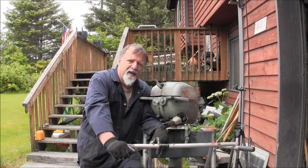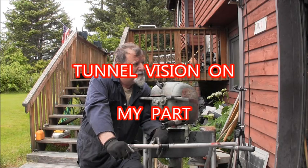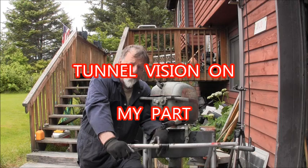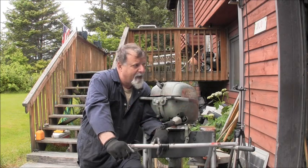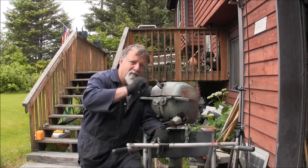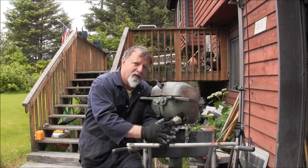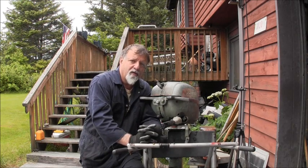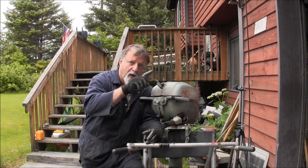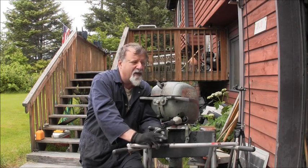So then I pulled the head off and I found the scoring on the upper cylinder. But I just cleaned everything really good after giving it a light hone. And do you remember when I was taking that pick and cleaning those channels around the piston sleeves, the water channels that run around the pistons, and I dug all that salt out of there and everything.